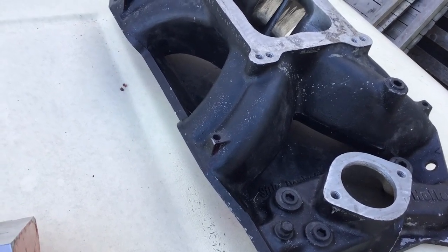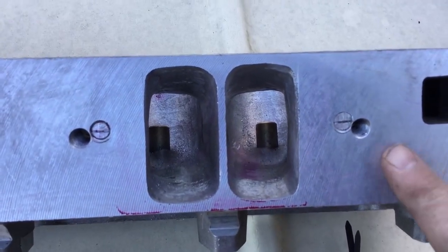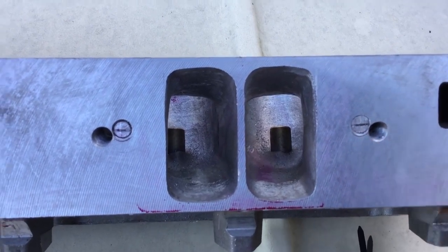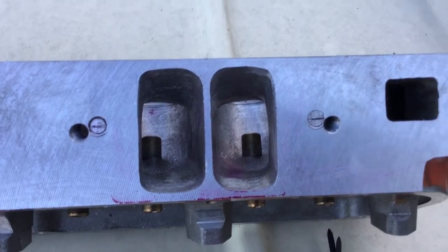Well, that led to a different bolt pattern. So you can see I got some aluminum all-thread from McMaster-Carr and made some plugs. I plugged the original holes, then drilled and tapped the new holes in it. Just simple stuff there.